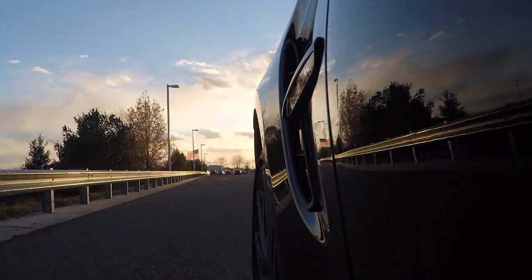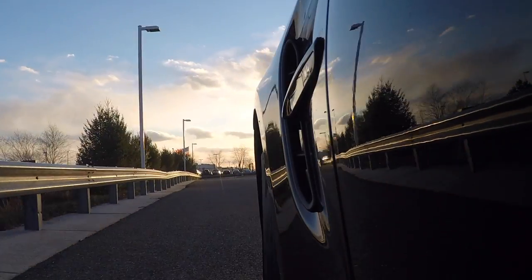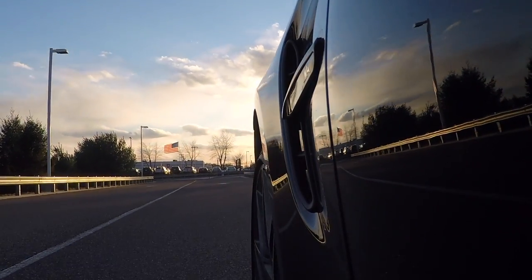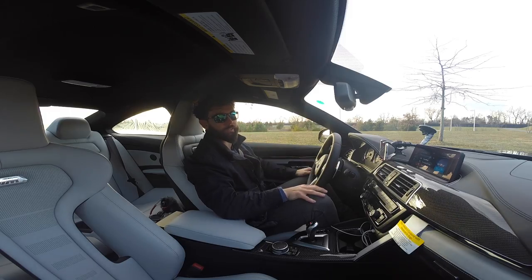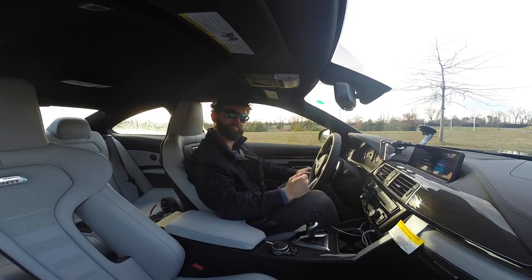The surface coating of the brake calipers can also get damaged. Leaving brakes to cool stationary is easy but less than desirable when brake discs are at a temperature of up to 500 degrees. Executing a cool down lap, you may find brake temperatures generally falling below 200 degrees. Have some respect for your noble steed, you peasant.